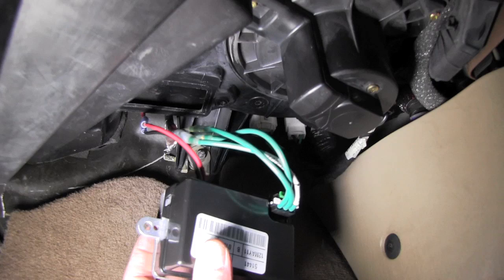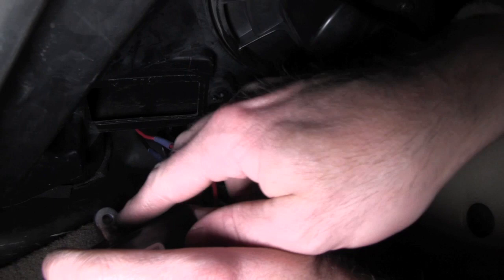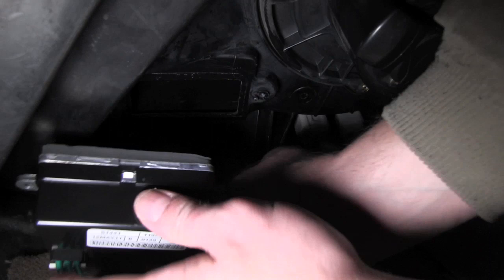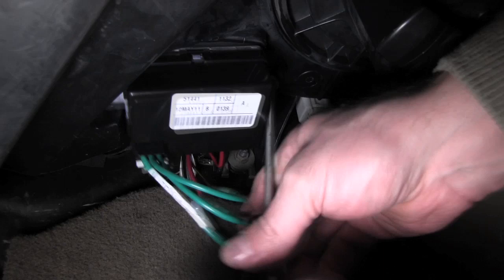We're going to have a little bit of extra wire hanging down. There's a little hole right here on the side — see the two holes? That's because we've got a pin right up here. There's a little pin and that pin goes in that extra hole, then the screw goes through the other hole. That's so you get this aimed in there the right way so that your gasket will seal it up and you don't get air blowing down on your feet all the time.